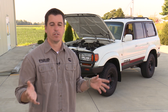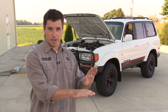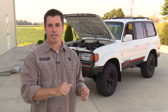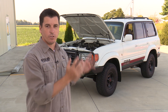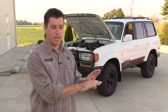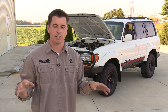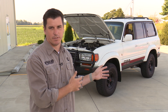If she had failed to do that pedal dance sequence correctly and went to start it with her foot on the floor, it would automatically rev up and you'd know you have not correctly initiated the test — so you can just back out, key off, let the ECM reset for a few seconds, and try it again. During the duration of the test she has to keep her foot to the floor as a safety feature. If she lets her foot off for any reason it will just abort the test, won't record any of the changes, and you can go on if you run out of time.